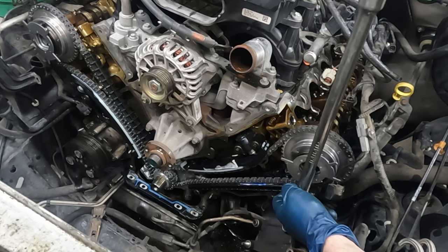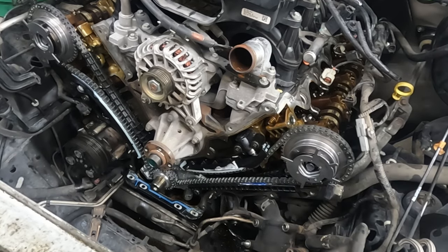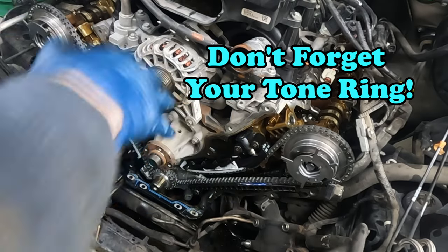I'm still a firm believer in going OEM - I believe that was a fluke, not the rule. Now we've got our initial 30 foot-pounds. To get our 90 degrees: take a contrasting colored marker and mark straight up on both bolts. As we tighten the bolt, this vertical line should become horizontal - that's our 90 degrees.